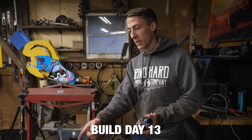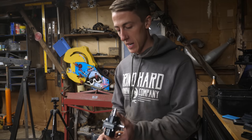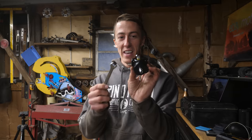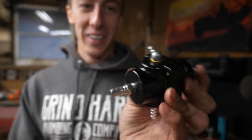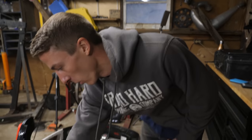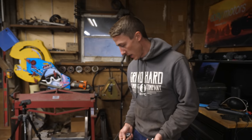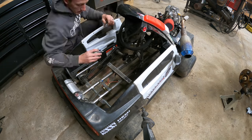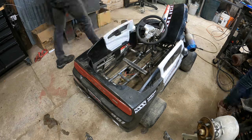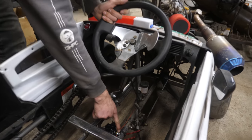We did a little troubleshooting and got the engine running today. Pretty sure it just flooded itself out, and we knew that was a possibility. We had planned to put this fuel pressure regulator in, but it can't fit the gauge and we don't need it anyway. So in true Grind Hard fashion, we've blocked it with a zerk fitting, and if that leaks we'll just weld it shut - we don't have an eighth-inch plug, so that's what we're using. We'll also be able to take out the restrictor we put in the pipe to slow it down and not overflow the float bowl.